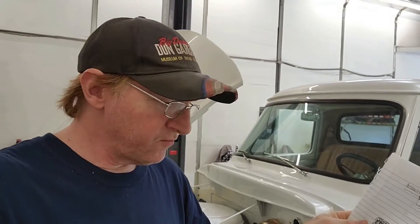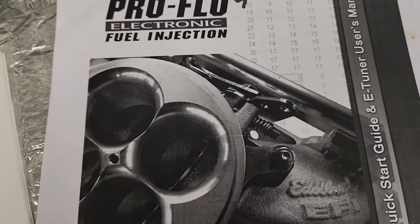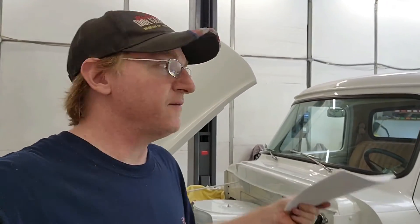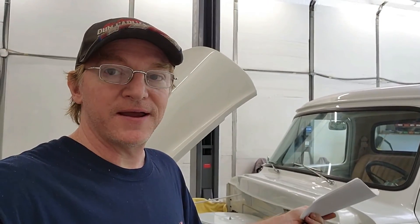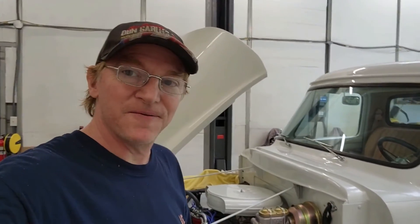Calling Edelbrock was something I wanted to do to let them know what we found here at the shop. They were really instrumental on the first phone call I made to them on something I had an assumption about that they verified. I wanted to kick it back to them to let them know a simple diode fix will take care of this, because a tachometer feedback issue is not a nice thing to have. You have to share that circuit, and sharing that circuit the only way to do it is a diode. Thanks so much for your time, we appreciate you, and we'll see you very soon in the next video.